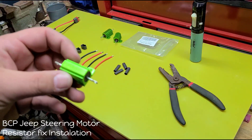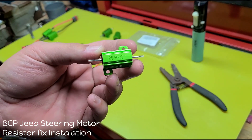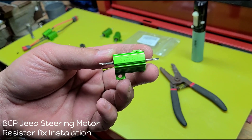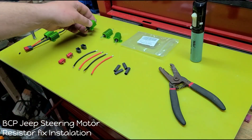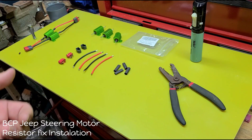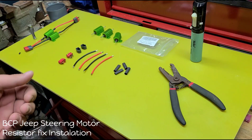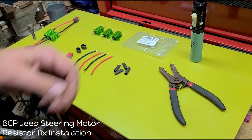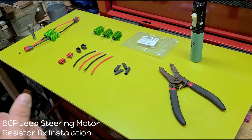What I found that seems to work: you're going to install one of these on each line. These are wire wound resistors — 25 watt, 4 ohm — with an aluminum heat sink built around them. They do get warm to the touch; that's not uncommon. They don't explode or anything like that if they go bad. You could smoke them out, but I don't think you will given this application — it's pretty basic and straightforward in-line.